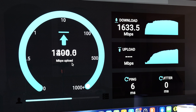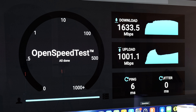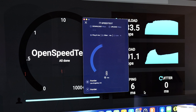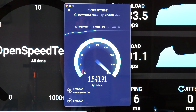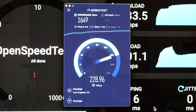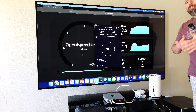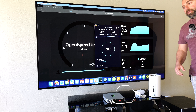The question is: should you get a Wi-Fi 7 mesh system if you don't have any Wi-Fi 7 devices, or only have one? It really depends on you and your internet speeds. If you're planning on using wireless backhaul, getting a Wi-Fi 7 mesh system may just be worth it. The main reason is that even if you don't have any Wi-Fi 7 devices connecting to it, it uses MLO to connect between nodes, giving you absurdly fast wireless backhaul speeds.